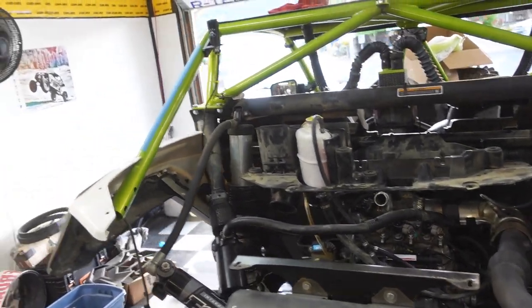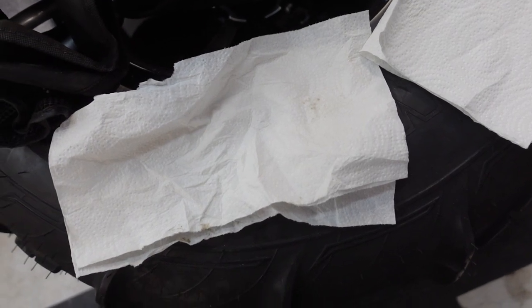Because now we ran it, a tiny bit of oil came out — but I feel like that was residual. Here's our test: I held this paper towel in front of the turbo and Danny revved it up. You can see a couple of little drops from the first few times. But after several more runs, you can see it's pretty much spotless.